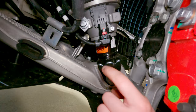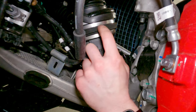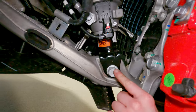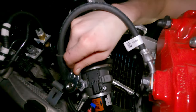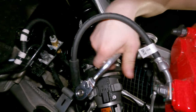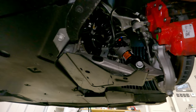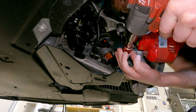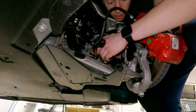You're going to need a drain pan — the car uses brake fluid for the lift system. We'll drain this brake line, pull them aside, and hit this 21-millimeter and 11-millimeter on the brake line.